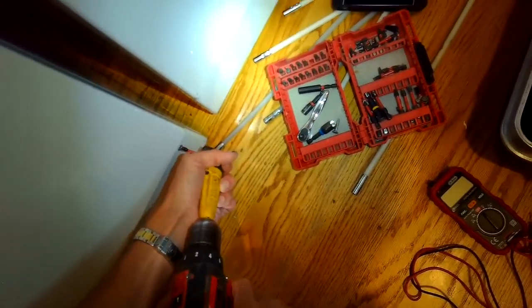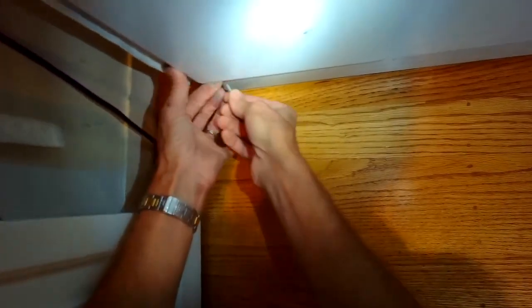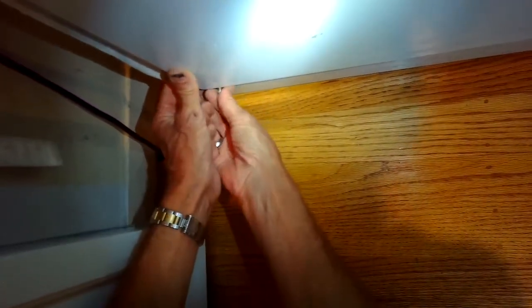Usually when I do these services I also do vent cleaning, where I clean out the vents just in case there's been any accumulated buildup of lint over time, because that will cause the high limits to trip. So it's good to do if you have one of those lint eater tools — it's a good time to take care of that.